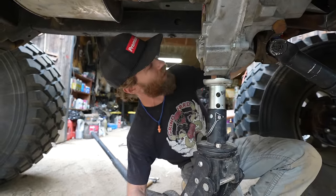Yeah, it's amazing what having better tools and being able to see does. I mean, there are a lot of factors here, but those are some of the prettiest welds I've done in a while. Not perfectly consistent, because you can see there are perfect temperatures on that side, but here and here, they're a little overheated. Barely overheated, really. It's still within a good range, but color-wise, this side's a little hot because there wasn't as much metal to soak up the heat right there.